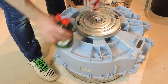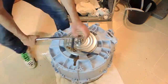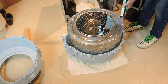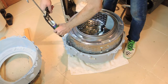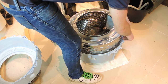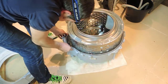Then the flywheel goes on — check it is not bent. I had to take the flywheel off again after refitting, so do be careful. Tighten it up as hard as you can without locking, then lock it in place and put it up to the specified torque. Check it flows and returns freely. Then put a decent amount of silicone — don't underdo it, but be careful not to overdo it either. If you overdo it there will be a huge chunk of silicone on the inside which you can't access. I did overdo it; it will come out through the filter, but it makes quite a noise and if you're doing this for a customer you wouldn't want to be called back.